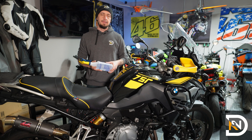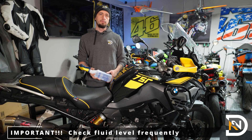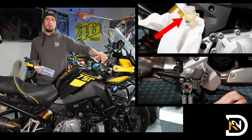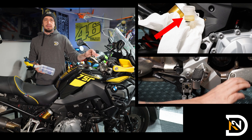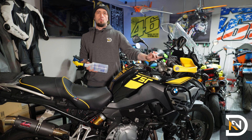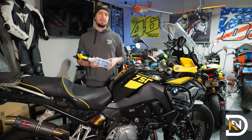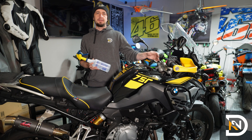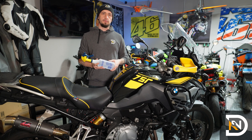The other super important thing to keep an eye on is the fluid level in the reservoir. Remember, as you're bleeding the brakes, you're actually pushing the old fluid out of the system through the bleed screws, which means the level in the reservoir is going to drop over time. So keep a close eye on it and top it off periodically. What you really want to make sure of is that you never get it to a point where it's going to start sucking air into the system. If you do get some air sucked in, it's not the end of the world — you just have to keep bleeding it until the air bubble works its way through the system, comes out of the bleed screw, and the brake lever feels firm again.